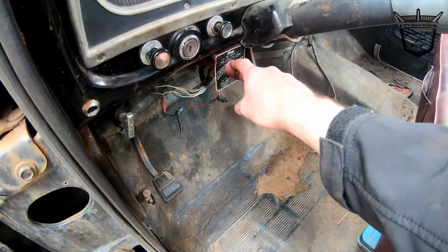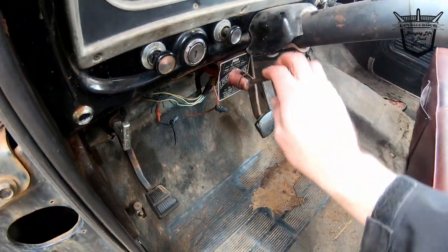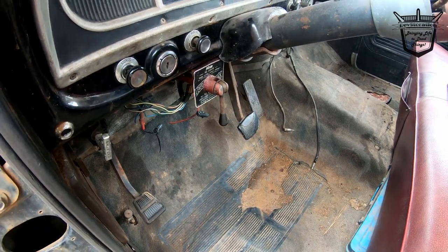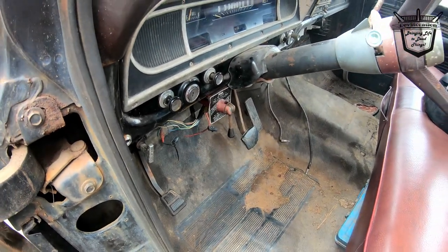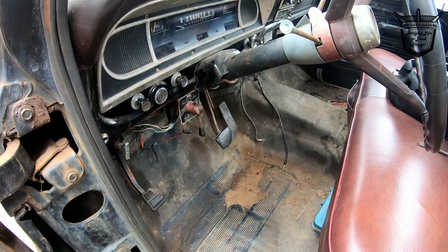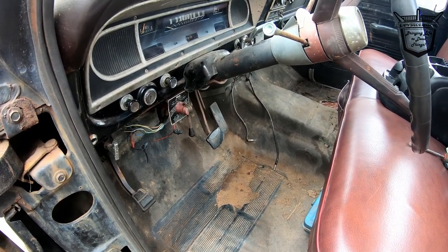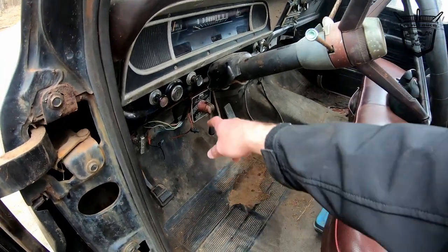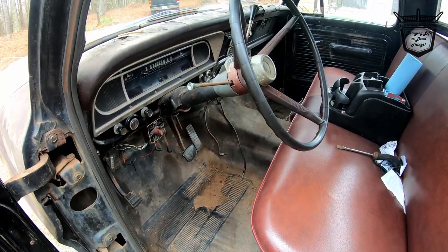This actually did a doozy on me. I had to take all of this locking system off. I was going down the road, just driving, and all of a sudden all my brakes locked down on me. I had to get over and figure it out. I actually drove it back with all the brakes basically being held down. What it was is it was letting in but wouldn't let out, so I had to bypass all of that to get it going.